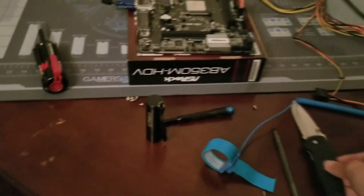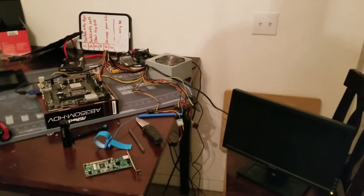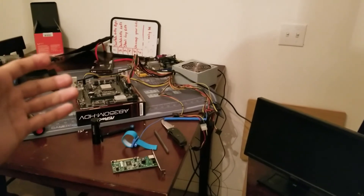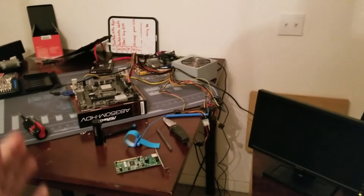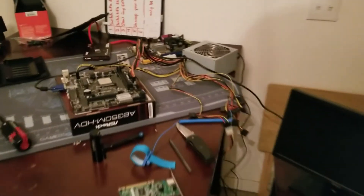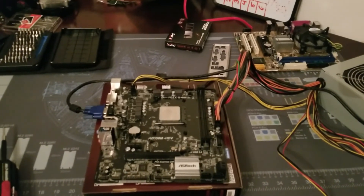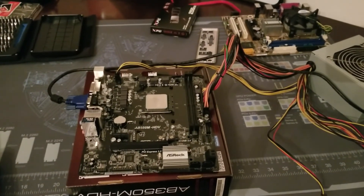This is why I like to document these things from a consumer's perspective. This would have been bad for anyone building a computer for the first time. One of the reasons to go with this CPU is the integrated GPU, which is actually not bad compared to Intel's options, and the video card market is rough right now — so this would have been perfect. However, motherboards in stock until X470 comes out probably have an old BIOS installed. Either manufacturers need to update the BIOS before shipping, or you need a working Ryzen CPU to update first.